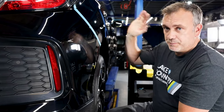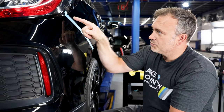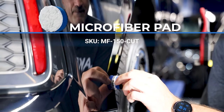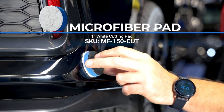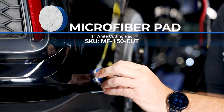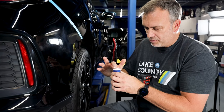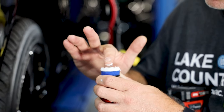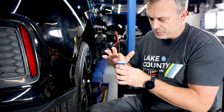I've masked up the part that we've just polished because I don't really want to re-polish that area. We've got all these tricky areas, so basically I'm going to show you that with a one inch pad we're going to do all these smaller areas first - possibly a two inch pad in some spots - and then the larger areas we'll do with a five inch machine. I'm going to put the most tiny blobs of compound on, gently pat that down and spread it so it's in as much of the fibres as possible.